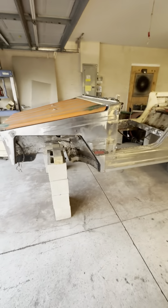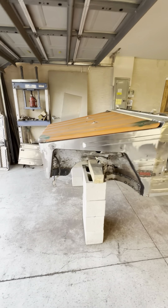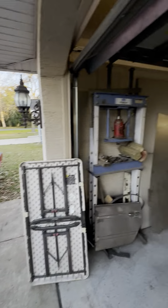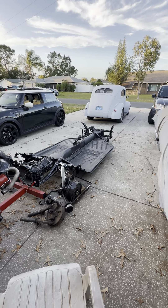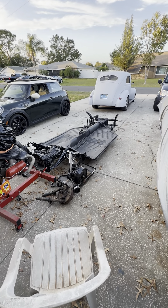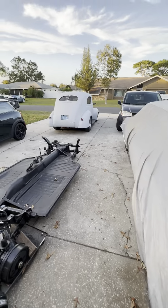God willing we're going to get the ball joint — could be a beam debacle — figured out tomorrow morning. If they give me the right stuff I'll come home and press them in. I'll also make a video showing how to do that: how to mark the orientation of the ball joints so you know they go a certain way — it's not just how they press in, it's also the orientation of a groove so they move forward and back, not side to side.